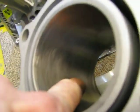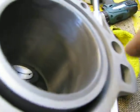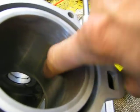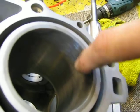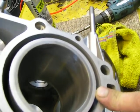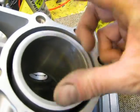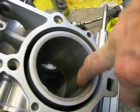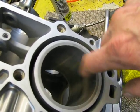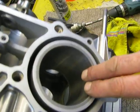There you see a line going up and down. That's from an end of a piston ring. And there you find also two lines. Yes, I know you don't want to have them, but they are there. And when I grind it out, you get a problem, because then the cylinder sleeve is too wide and you will not have enough compression. Those lines, you never know. You don't know it is there. You don't feel them. This engine will perform like the other ones.